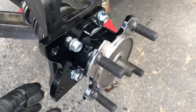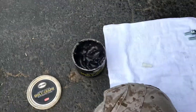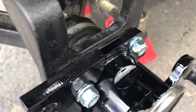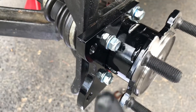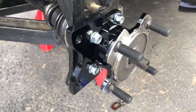We got the hub on and everything's loose so I can show you what's going on. We used some moly-graph grease on the spline area of the hub, because this thing does move in and out and you want some grease on there. The short bolts go on the back because they just have to go through the hub, but the longer ones need to go through both the hub and the bow tie. Lots of blue Loctite on all these braking parts.